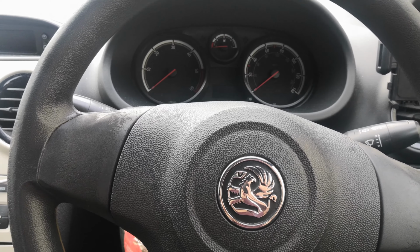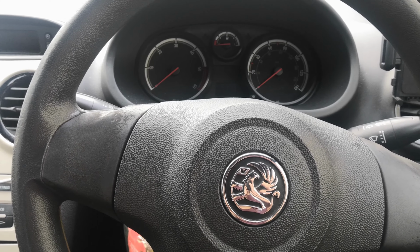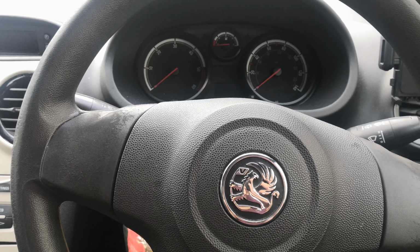In this video I'm not really doing a how-to on how to take things apart. The rear splash guard on this is held in with some little 10mm nuts. You just pull it out of the way, the sensor unclips, and I have butt crimped in a little piece of cable to repair it. Taken out the oxidized cable, which you'll see in a little bit.